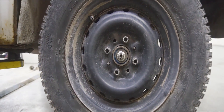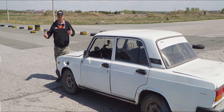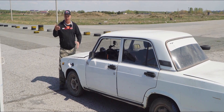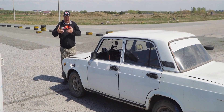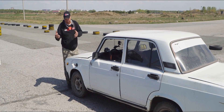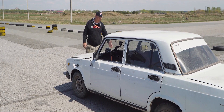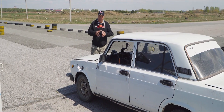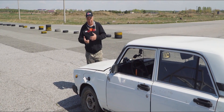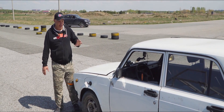Here's what's going on, fellas. We've made it to the test track where there's plenty of space to play around. At the moment, the front left wheel bearings are completely dry - you would have seen us washing out the grease and putting everything back together. We decided not to pinch it, just leave it dry. As for the one on the right, it's lubricated, but we've tightened it down with way too much force. I've got the race logic in the car, so we're completely set.